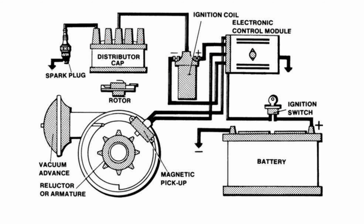So let's get to the operation. Inside of our battery we have 12.6 volts. The whole point of an ignition system is to generate enough electricity to jump across this little gap right in here at the spark plug, and to do it at the right time. So we need to do those two things. We need to generate about 10,000 volts here to jump across the spark, and we start out with 12.6. How do we make that happen?